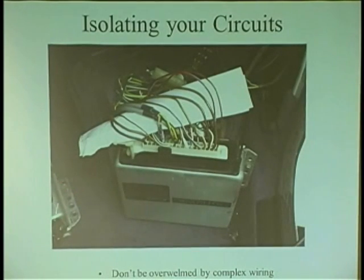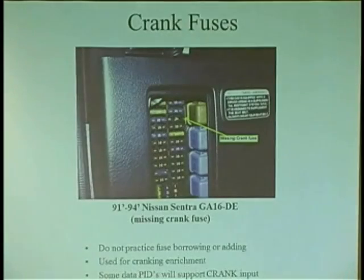But I went in there and checked. Power here had power. Went over here, no power. All it was, was a bad relay. There was no ignition feed going to that ECM. That's all it was. But yet, you see right here? Oh, let me just zoom out. You see right here? What's laying over there? ECM. This guy tried an ECM. But it's so easy once you pull these wires out to check ground, ground, ground, power, power, you're done. So just simplify the job by pulling out the wires that you just want to check.